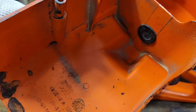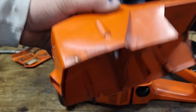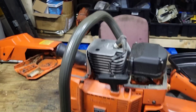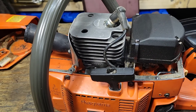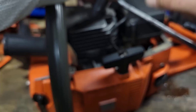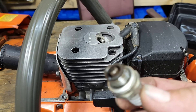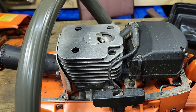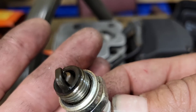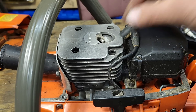This isn't too bad, it's pretty clean under there. I did clean all this when we originally did the saw. 300th anniversary - that's an old company. This saw is nice - look how clean this thing is, you can tell it's a new build. We've done everything and anything we can to this saw. For a piston or spark plug inspection, it's nice to do it after you've run the saw. I could tell that was golden brown - you can kind of see the electrode there - so we're good with that.